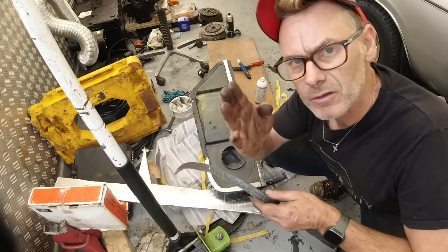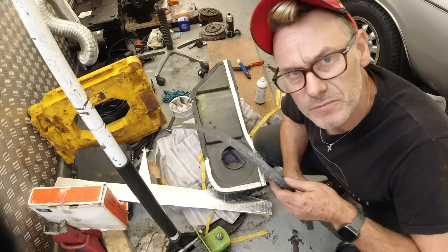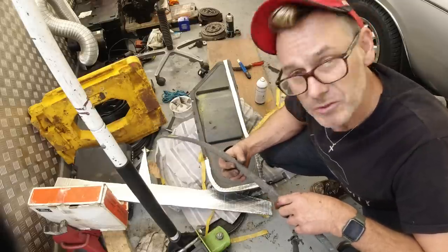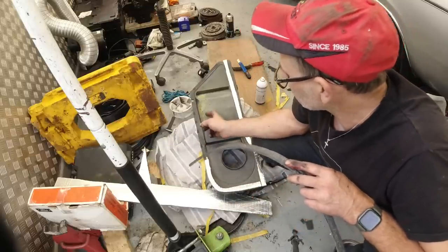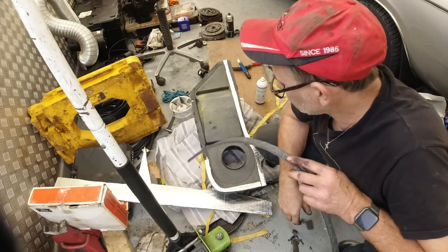It hasn't got the hot air diverter flap built in because it was for export. PAPPA was built to go to South America. So on the production line at the factory, they would have picked a Delanair hot climate unit, which is basically exactly the same, but it just doesn't have the flap inside to divert hot air through the heater matrix.